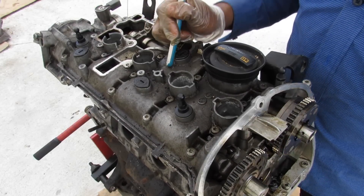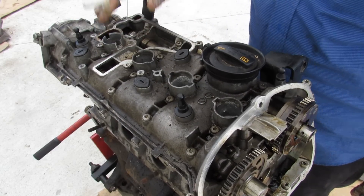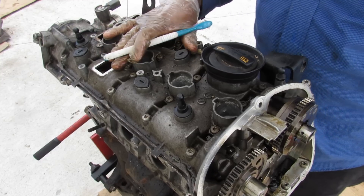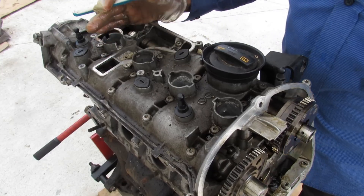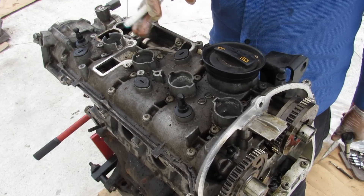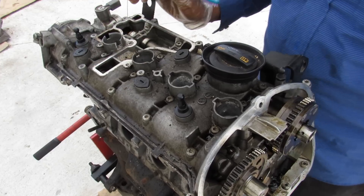Now let's take a look at the valve cover. At the top of the valve cover, what's missing here is the PCV valve or oil separator, which works to ventilate crankcase vapors and burn them back through the intake. This is a cause for a lot of failures on these engines because the PCV can either clog up or cause a lot of oil burning, and it may need to be replaced. Luckily it's right on top and pretty easy to get to.